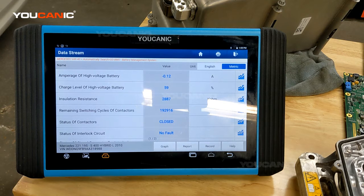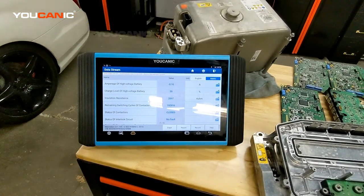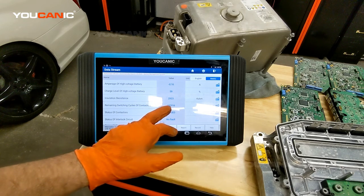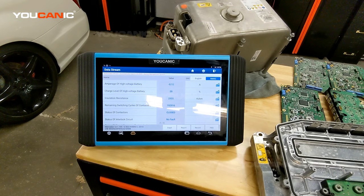But that's what a contactor is: the switch inside that disconnects and connects the high voltage battery. Closed means it's connected — there's power coming to those terminals. Open means there is no power. A lot of times when you have issues with a high voltage system you'll see codes, and the status of the contactor will say open — it just means there are other fault codes or issues with the hybrid system preventing the contactors from operating. Also, if the cycle counter goes down to zero, the status of the contactor will stay open and you will not be able to use that battery anymore. Hopefully that explains what contactors mean in a hybrid vehicle. Thank you for watching.